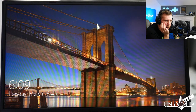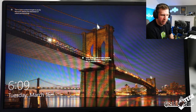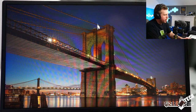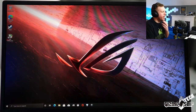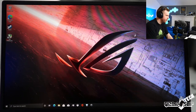What laptop GPU and TDP is ideal for 1440p on high settings? I would say any of the new RTX 3000 series with a high TDP. So a 3060, 3070, and 3080 would be enough. Also, RTX 2070 Super and better for the 2000 series would be able to do most games at that resolution. If you go to ultra settings, that's when you're going to want even better, though, right?